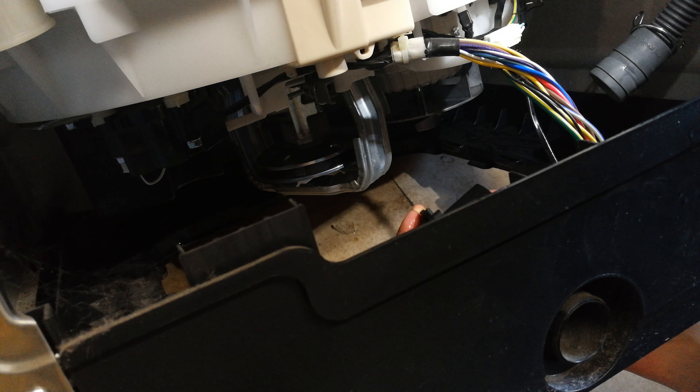That seems like it. Just to sum up — I put my finger in there and was pushing on these blades, and as I said this thing didn't want to turn. This is the little impeller. What was probably happening is this rivet was jammed in there, and that's why it was not spinning — therefore not causing the water to come out.